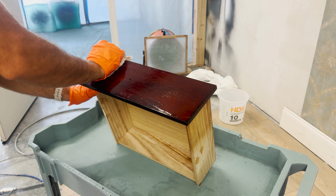And then from there, I'll move on to polishing with a wool bonnet and a cutting compound like Meguiar's Speed Cut or whatever. Then I'll use a finishing polish with a black or a yellow disc. I only have a pneumatic 3-inch polisher, because that's the cheapest thing they sell at Harbor Freight. Until I'm committed to doing things like this, I'm not going to spend any more money on equipment. I use the 3-inch polishing disc and just hook it up to my air compressor and go.